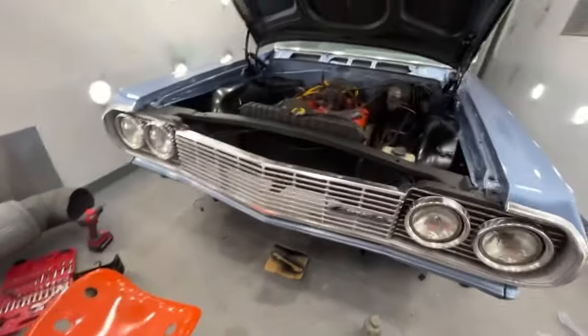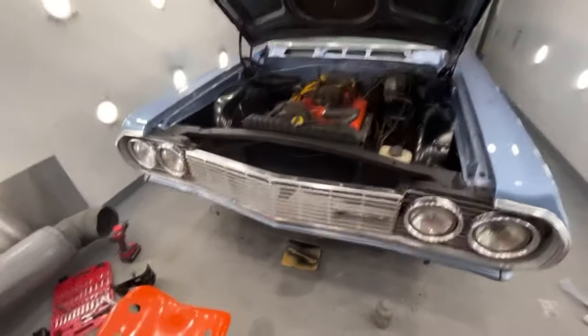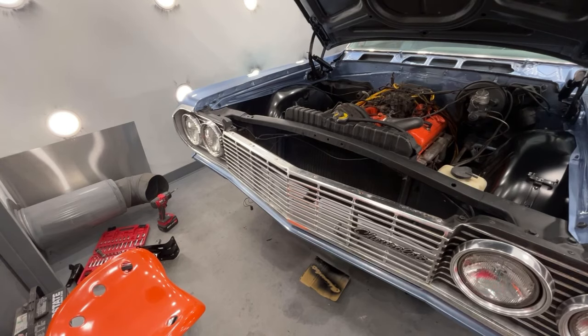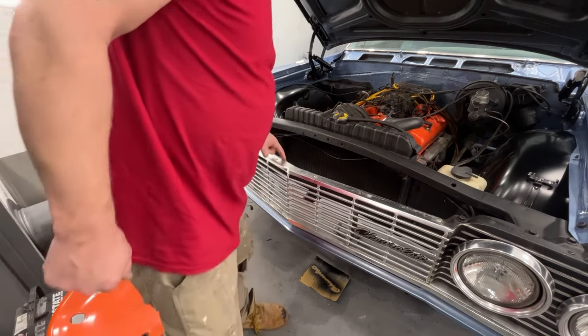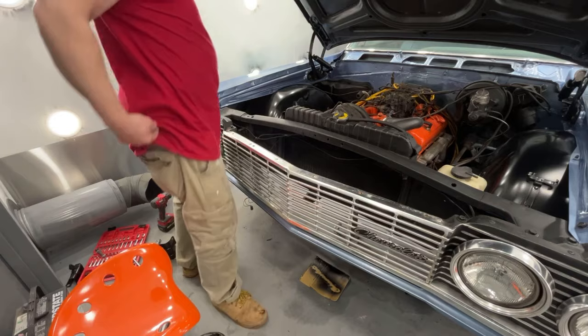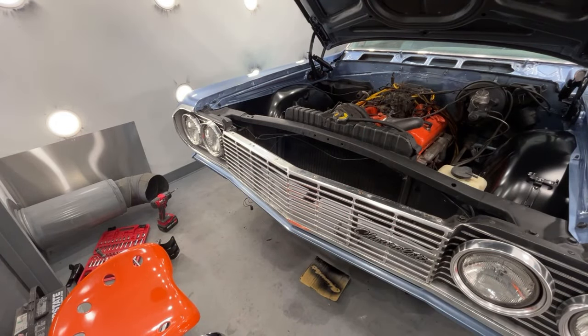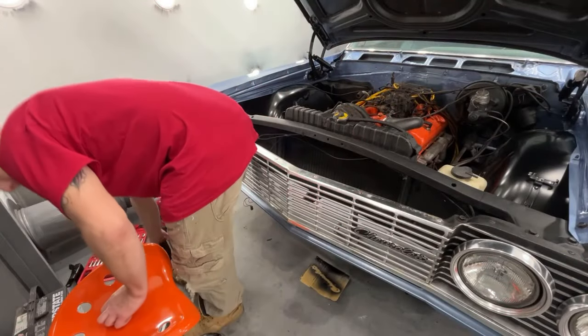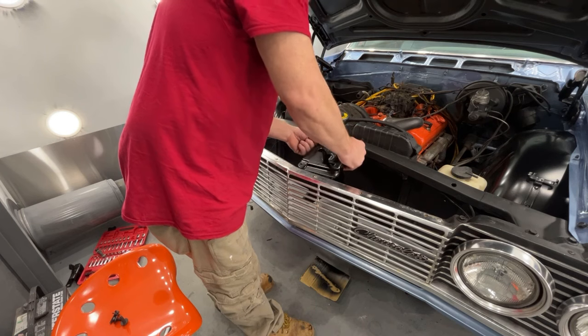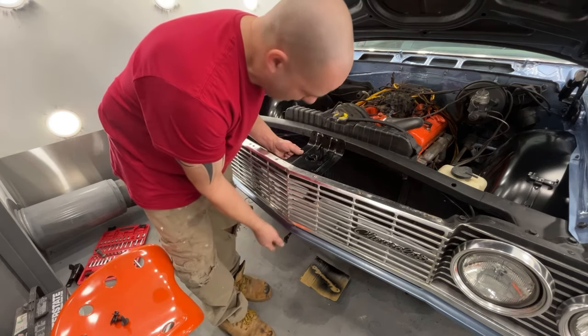Okay, I just put that lower molding on the grill off camera. Now I am going to put the hood latch assembly in, which I'm gonna grab a couple bolts for. Four of them. One of the nuts on this one is missing, but I don't know if there's a bracket that goes in there or not. If there is, it's missing. But what we will do is drop this in and start these nuts. So this bar goes down underneath the grill assembly and underneath this lower valance, and it sticks out below the lower valance.